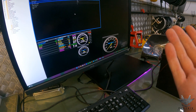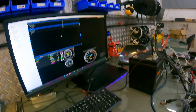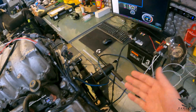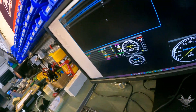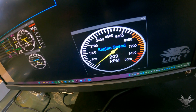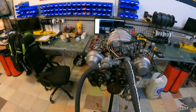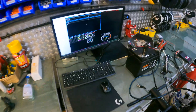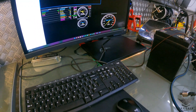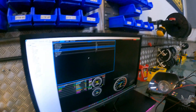With a well-tuned engine, 400 RPM for your starter deactivation will be absolutely fine. I'm going to crank it now with the fuel disconnected so we can monitor exactly how fast the engine is turning over. Bear in mind this engine is on a stand with no gearbox or anything like that, but this will give a really good indication of how low you could possibly set it. You can see on the RPM gauge we are cranking at around about 200 RPM. So if we set the starter motor to cut off at 250 RPM we'd probably still be all right, but anything lower than that and it's not going to start effectively.